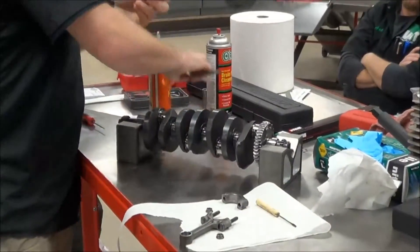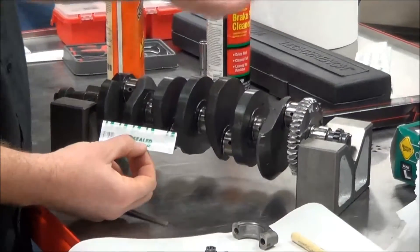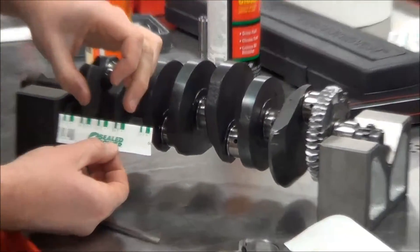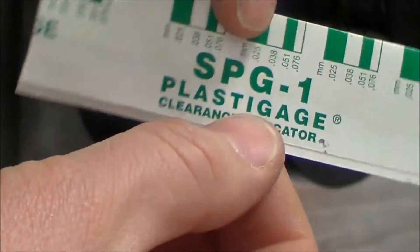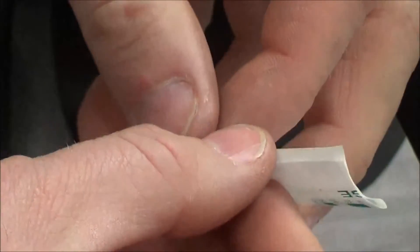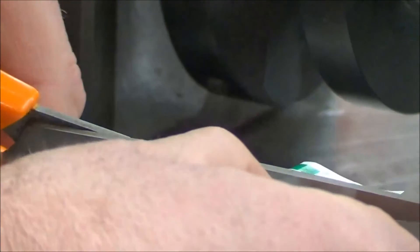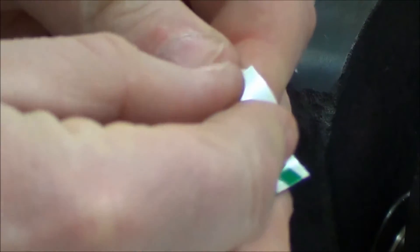We'll start off with our plastic gauge here. It comes in these tubes — you have long strips like this, and then we'll keep cutting them down to size. On this one here we actually have five pieces left. On one side we have standard, or thousandths of an inch. When I flip this around, this side gives us a metric scale. So depending on what you're more comfortable with or what your service manual is asking, you can use this for metric and standard. I'm going to use standard. I'm going to verify that my piece of plastic is inside here — you can see it's just inside this whole tube — and then I'm going to cut a piece off. What that gives me is a scale, and I'm going to lay it across here, torque this down, and then check the width of it to see what my clearance actually is.